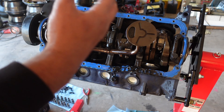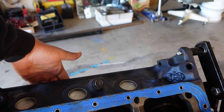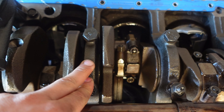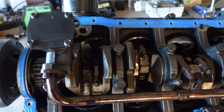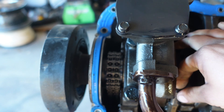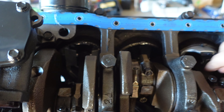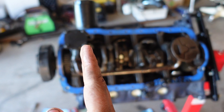Looks like a bottom end — it looks like a motor. So it's this piston that we think is trouble. What we're going to do is pull a main cap and pull a rod cap. The easiest way to check for rod knock and spun bearings — usually you can rock the caps. There's no piston movement except forward and back, and none of them move the wrong way.